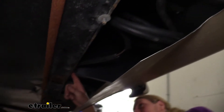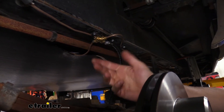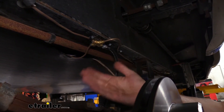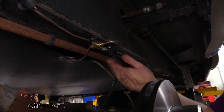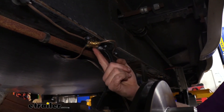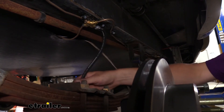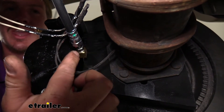Once we get it coiled up, we continue on and it goes right here to above our axle. At this point we can start using the rest of our lines and unions to get everything hooked up to our brakes. The routing path we just took is for our trailer's layout — keep in mind that depending on the floor plan and options chosen, the layout underneath could have various other components like slide-outs, so your path might be slightly different. But once you get back here, we're going to start with our four-way split: our main line goes in, and on the opposite side we have a flex hose that goes down and connects to our caliper. We chose this one because we wanted the hose angled to keep the flex hose on the back side on the inside of our leaf spring stack. When tightening down the flex hoses, they use the same 3/8 line wrench.